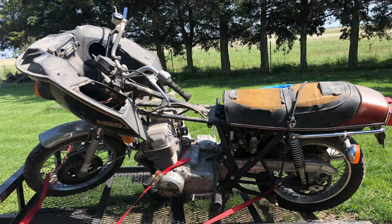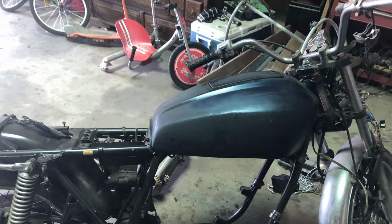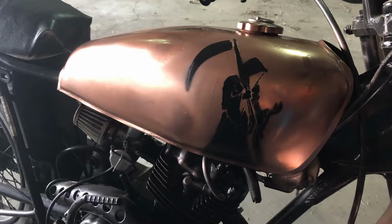But my next video is gonna be me trying to get those pistons inside the block. I'm gonna try to go the cheap route and just use some hose clamps for now to try to get the pistons in. Watch some videos, looks possible, doesn't look like it scratches anything up or hurts anything, so I'm gonna try that just for the simple reason that I didn't want to buy the piston compressors for maybe a one-time use. I don't know how many bikes I'm going to get this far into. The last, that 78 XL100 that I have, I really just had to do some basic work on that, no real engine work. So that's what I'm going to try for.